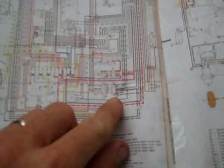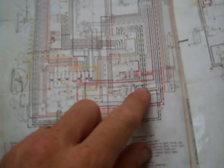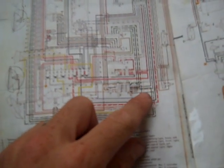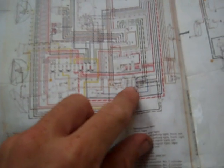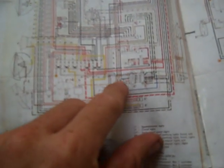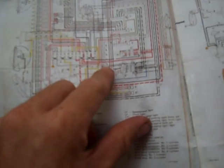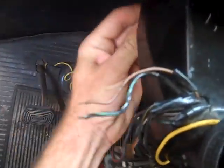There's a five-piece connector where all the coordinating colors come out the other side, and the colors from my switch correspond with each one. This one has five on it, but when I got in there I found one that has six — that's because my brown wires that come out for ground go into there, so I've got that sixth one. One thing I did was underneath here there are four screws that hold your steering wheel in place.